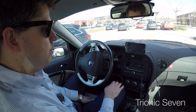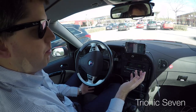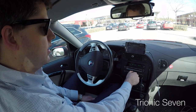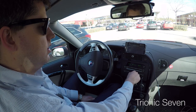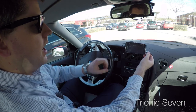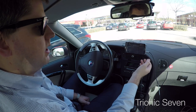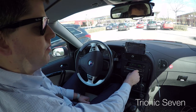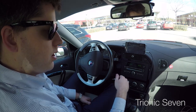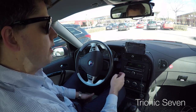Now we're done, and the stereo is set to the auxiliary input with the cable inserted. Let's try some music and see if it works. Yeah, it really does — and it's automatic! I can unplug the cable from the phone and it will pause the music; if I plug it back in, it will continue playing again. One difference is that if I disconnect the cable from the head unit, it will not automatically switch back to the radio, because we disabled the automatic sensing feature. So you'll need to manually switch back.